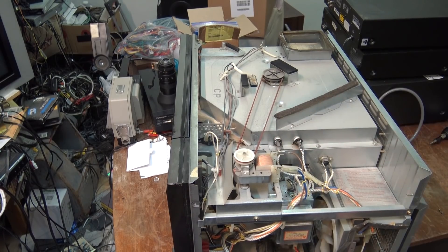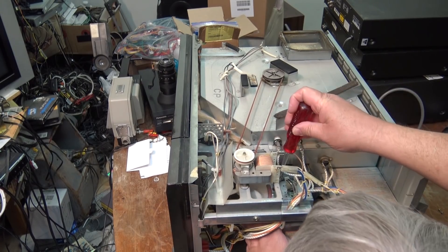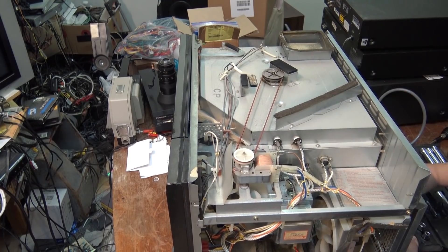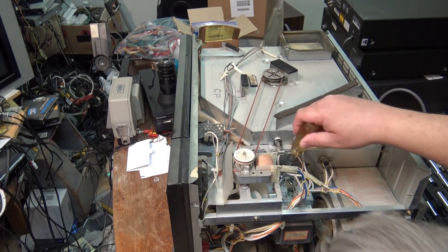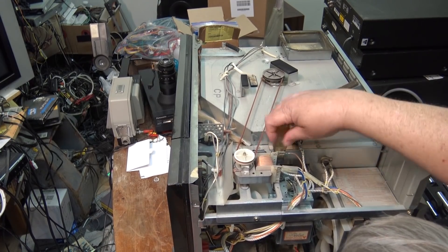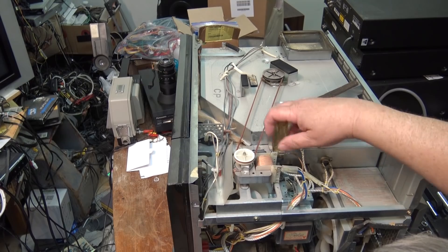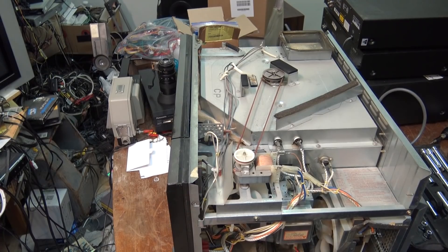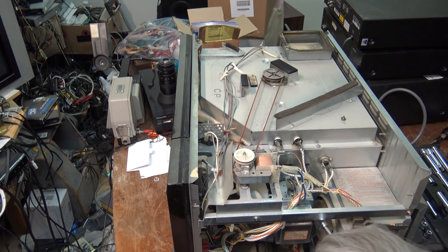It's a quarter inch. That belt on top that we're talking about — that's for the stirrer fan for the convection oven, to blow hot air around. Because this is a convection unit as well as a microwave. You can see the heating element at the top there. It's got a pretty hefty power supply in there. From the standpoint of being an iron core, it's 600 or 700 watts, one of those.